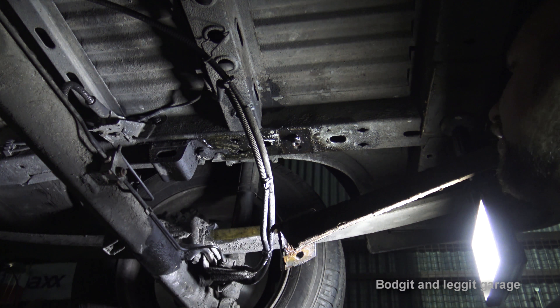I'm going to struggle for light but I'll get it as best I can. It's going to be quite noisy because I'm going to be using an air chisel. I'll show you how to work it off and then I'll either speed up the video or edit it. You can see here — I've just welded a stud on the top. I didn't put the weld in the middle; I welded along the top because it's a lot stronger, you can get a lot more weld there.